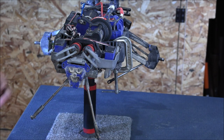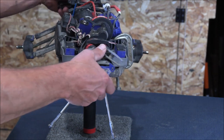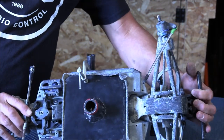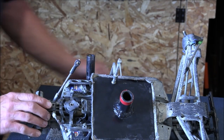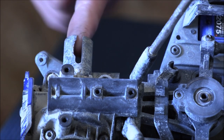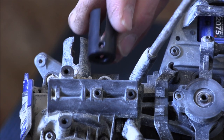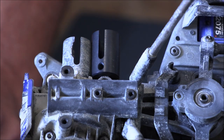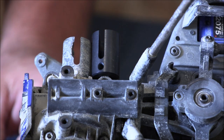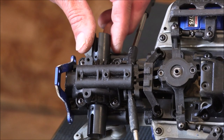To get the rear pins out, take the rest of this off. After you get your bolts out and the long one that comes out of your steering saver, pull the skid plate off and now you can access the two pins right here - same size as the lower front one. Grab it with duckbill pliers and pull very gently. Now this control arm will literally just fall right off. That'll pretty much take care of the disassembly of the control arms. Before we start putting it back together, let me show you how bad these drive cups are - look at the groove that's on it right here. Here's a brand new one to compare - look how close that slot is. The back is even worse, so while we're right here I'm going to replace these.